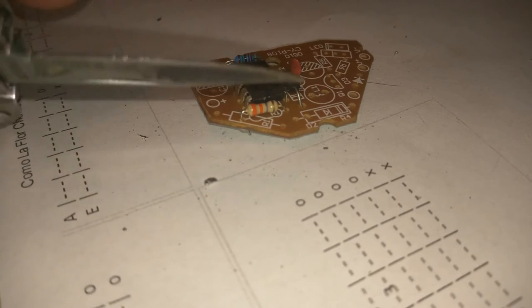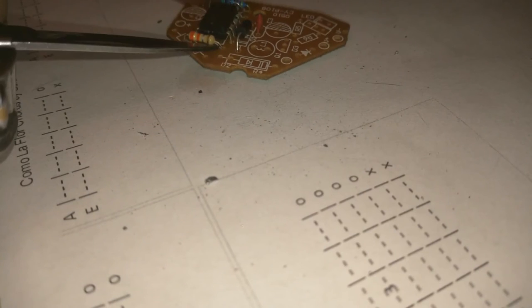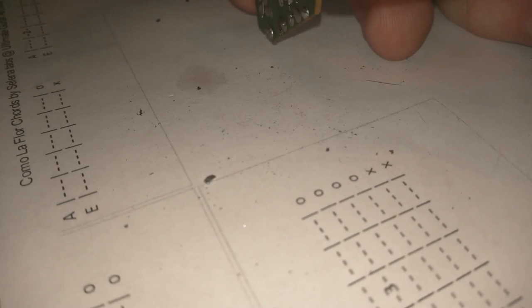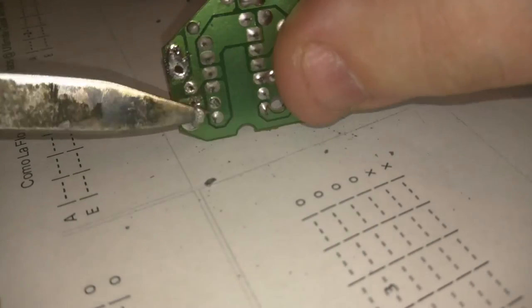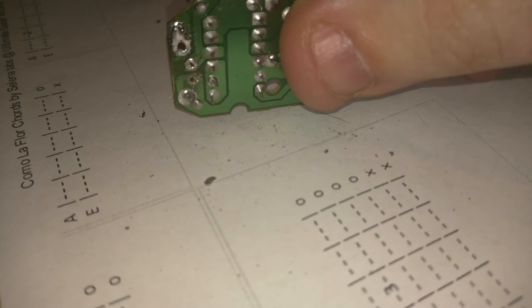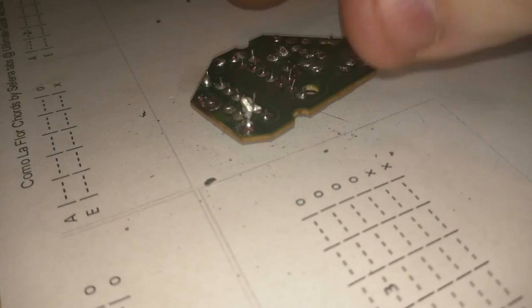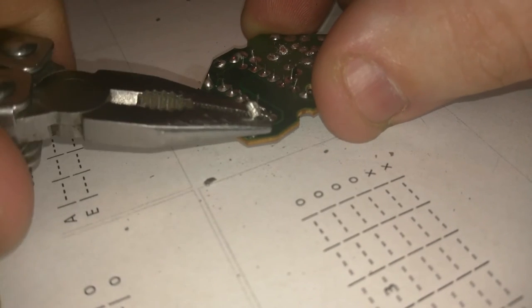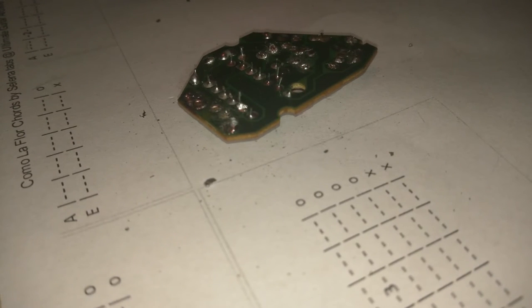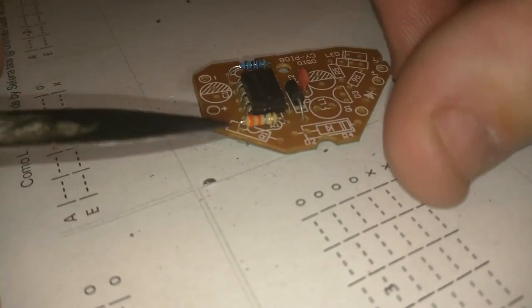And that is probably just to limit the rush because it's a mobile application. You get transients and stuff like that. And just dirty power. I mean, sure. Car's nice 12 volts. Well, not really. That's what everybody thinks. Car, it'll jump up and down and up and down and get off there, you blob. Wanna do something? That little blob. It'll jump up and down, between 12 and, actually, not normally, 13 to 15 volts. And so, things like this don't like that.